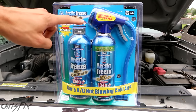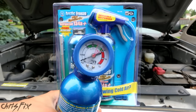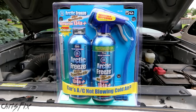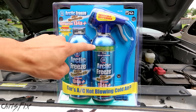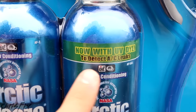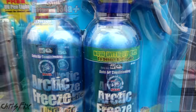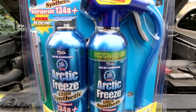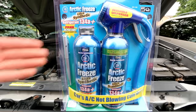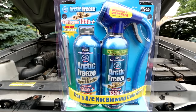Next, you want a kit with a built-in gauge. This kit comes with the gauge and the nozzle that attaches to the top, so you don't have to buy any special air conditioning equipment — it plugs right into your air conditioning system. Finally, you want a kit with UV dye. The UV dye is what lets us detect the leak; it's visible using a UV light, which also comes with this kit. Without the UV dye, refrigerant is just clear gas so you won't be able to see where the leak is. I'll leave a link in the description to where you can get this kit.